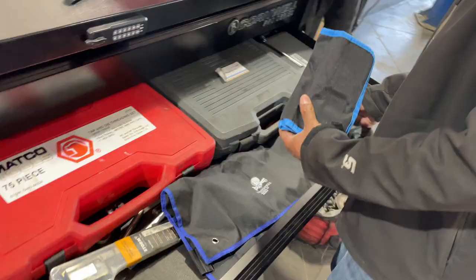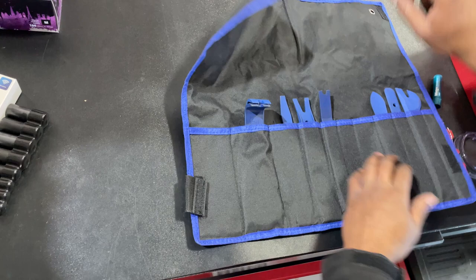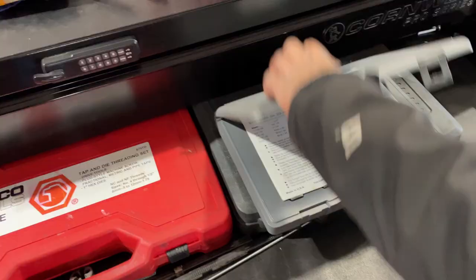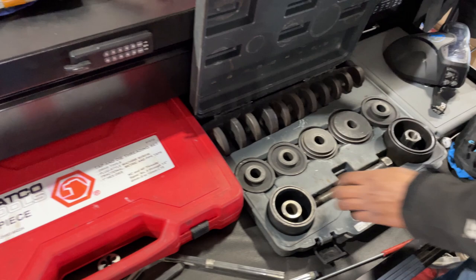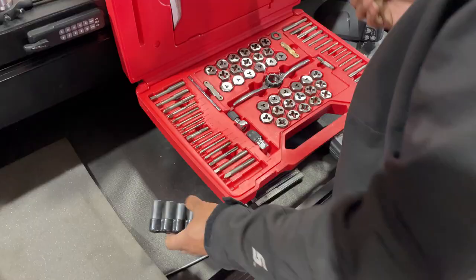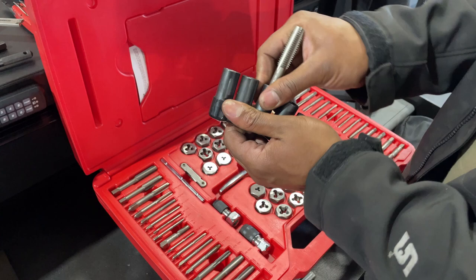Next drawer down: a little welding mask, a plastic panel kit for popping off panels and clips, and a 20-piece axle re-threader - genius for when you've mushroomed an axle by pounding it out. A wheel bearing kit for pressing bearings out without a press - gets the job done. And a master tap and die kit. Got some sockets with square holes at the bottom that fit splines perfectly - you just swap it onto the end.